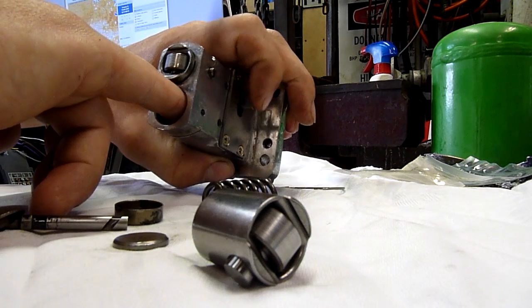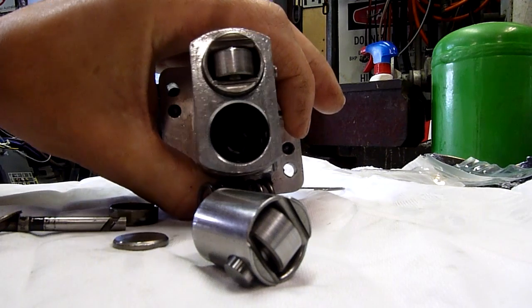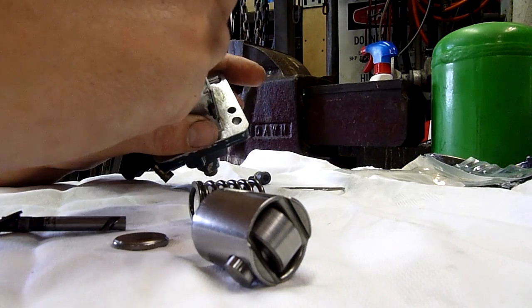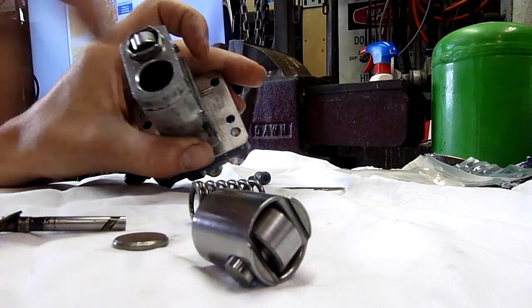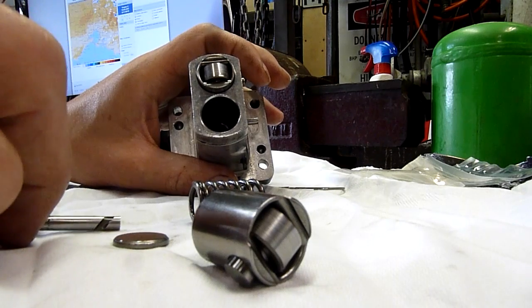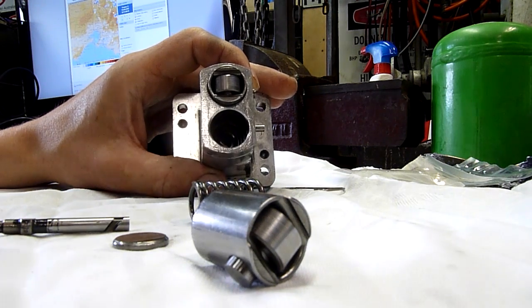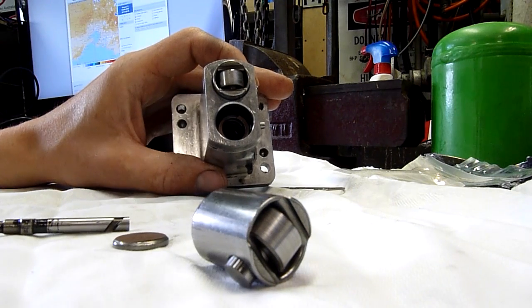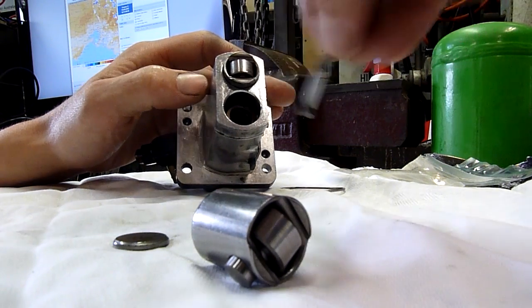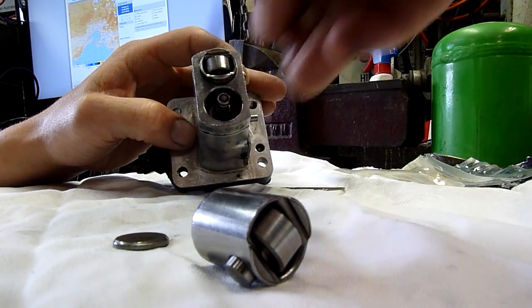Let's try and finger it into position. There we go. Now this is all engine oil side apart from where that piston goes, so everything's pre-cleaned and pretty good, but this side has had water go through it at one point, so there's a bit of rust pitting on the components. The seat's in. Now the main spring — spring drops in. Then we can start to place the piston. Make sure it's clean. Drop it in.